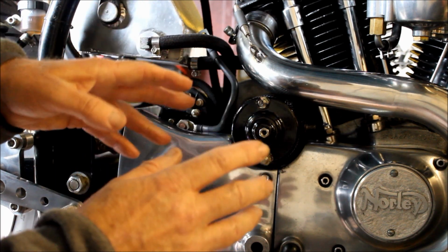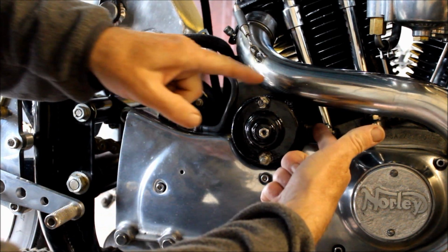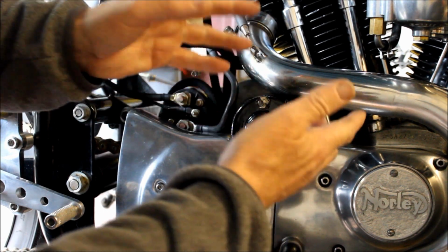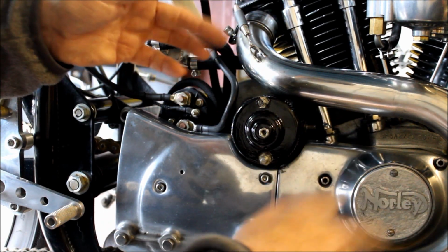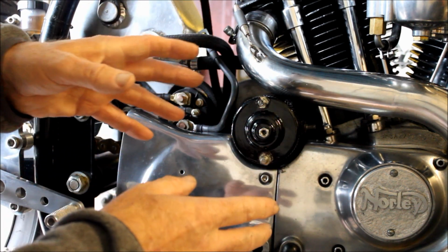And what's interesting is that was powered directly from the car battery on the live and the earth of this starter motor, and nothing happened. And really that should have spun round then, and I'm not sure why it didn't. And maybe that's the cause of all my problems.